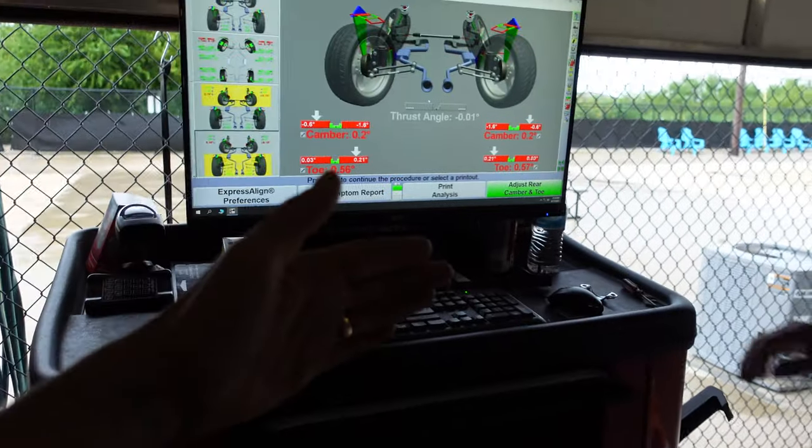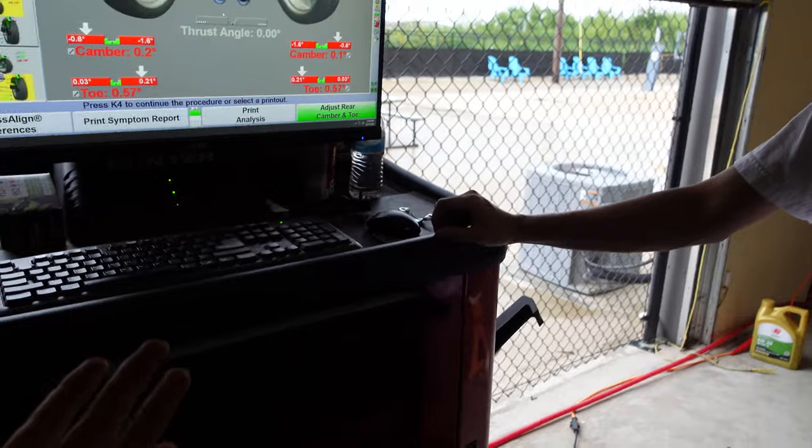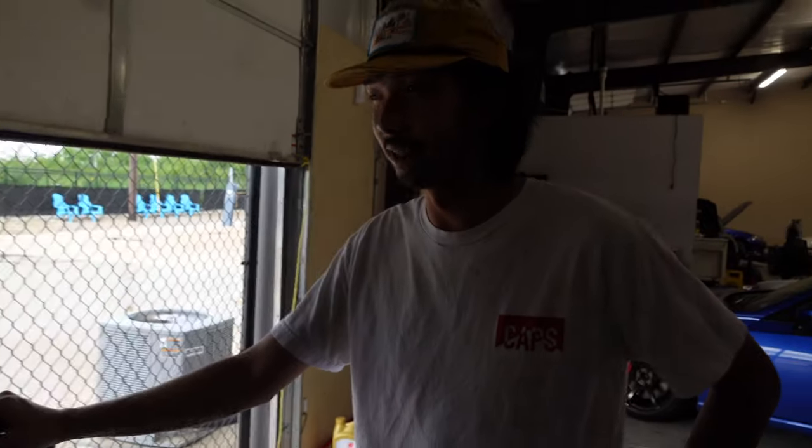So too much toe in can equal like a zero. Then it's just getting no bite. Yeah, absolutely. I think that's what happened to Andy. So really we're only getting max toe in under those moments of full on load. You're squatting, you're getting that toe in.